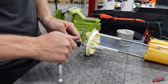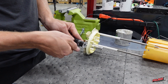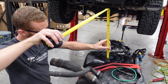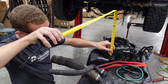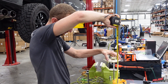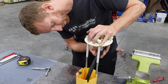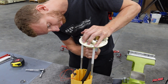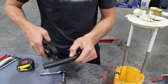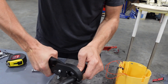Install STF-1001 into FL-1007 with hose clamp HC-1001 and tighten accordingly. Using a tape measure, measure from the bottom of the fuel tank to the top of the O-ring sealing surface and note your measurement. Compress the fuel tank module to the noted measurement, then mark and trim FL-1007 to length. You will want a quarter inch to a half inch of clearance from the bottom of the fuel tank module when it is compressed to the noted measurement.